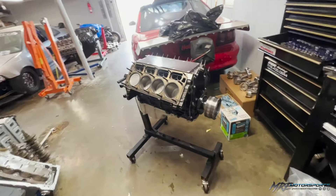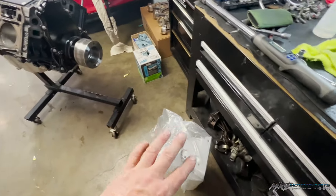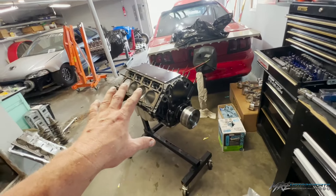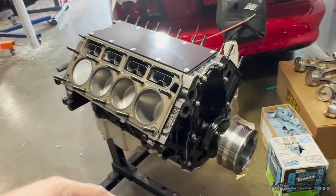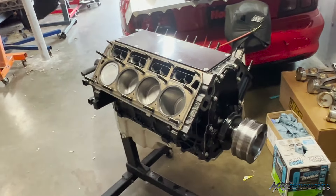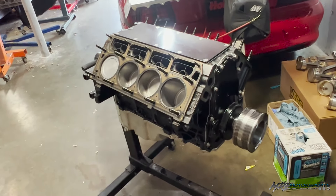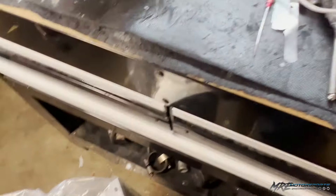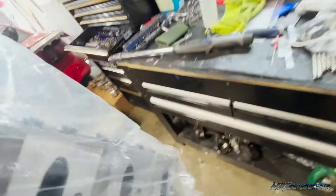We got some parts here from JEGS and I'm gonna try these — I got a set of cylinder heads for this motor. The heads originally were cracked around the head bolts, so it was getting water in the oil, which is why this engine was a nightmare. I told him we had an option to buy a completely assembled cylinder head from JEGS, and we just said hell with it, let's do that. So we've got a set of them here. Let me set one up and show you what they look like.